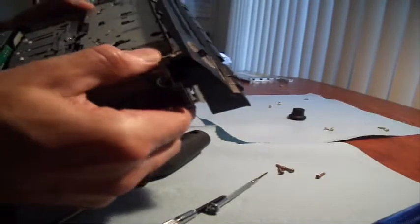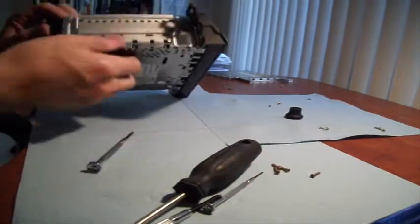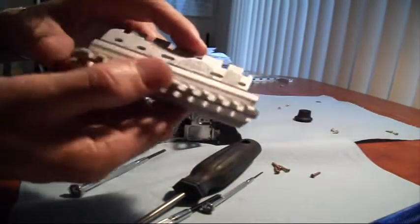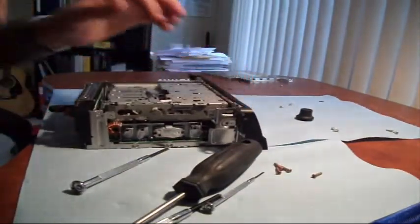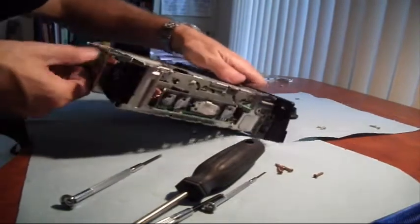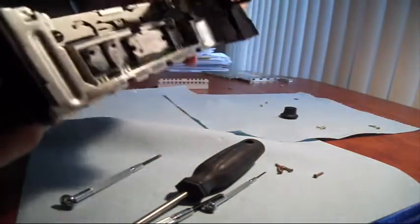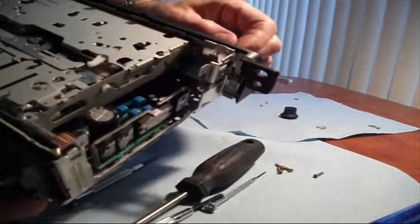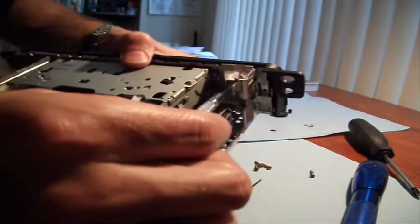You may be able to get access to this by just taking this side up. Take this up and off — there we go. And you can see some heat grease — white grease there. Don't wipe that off, because that's your power amplifier there, and it's all got this white grease on it that helps conduct the heat away from the amplifier and into the metal, so the metal can dissipate the heat. Right now we've got full access to this broken tune knob. The plastic has gotten broken away on the tune knob — you can see it's loose. We just want to affix that back in place. And it looks like there's one final screw right here next to this volume knob.